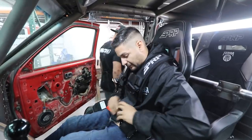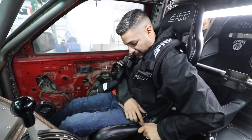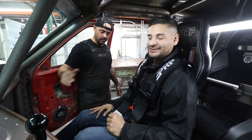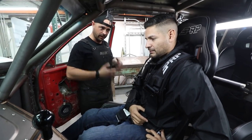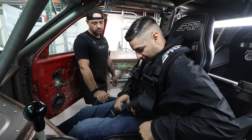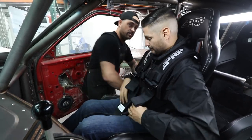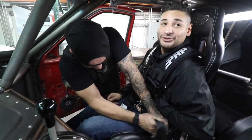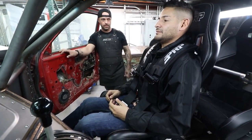Whenever I hop in a car, as Morgan went over, I check the waist — keep it right where your belt line is, down low. We're not experts, just pre-runner guy stuff, so take what you need and leave the rest. What I always do if I know I'm gonna go for a real ride is push my butt and torso into the seat where it's supposed to go and make the best posture I can. Then I'll push my foot on the firewall or something to push off on, get my butt back in the corner, feel how the lap belt sits first and foremost, then adjust the shoulders.